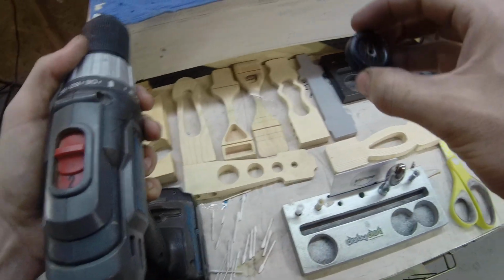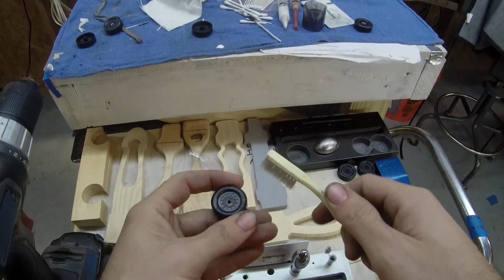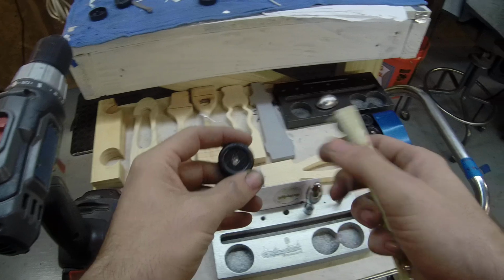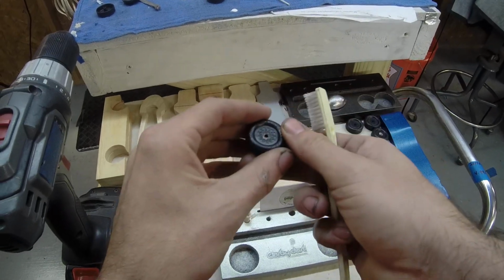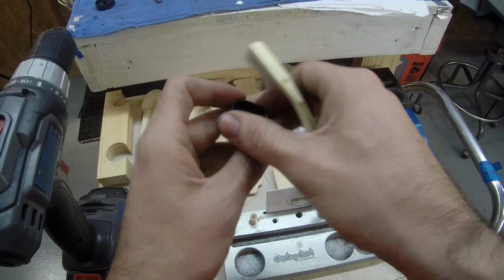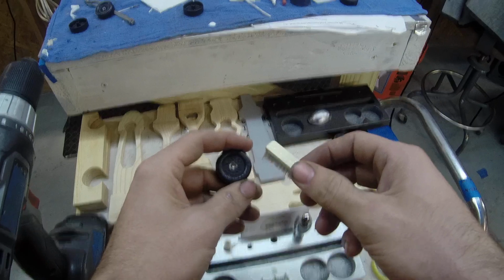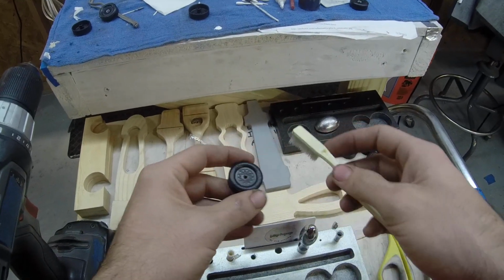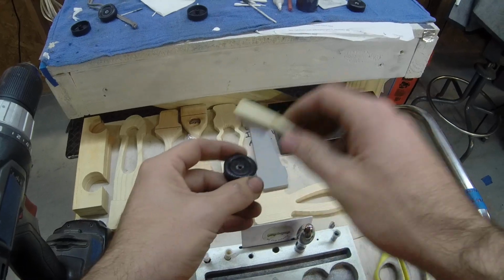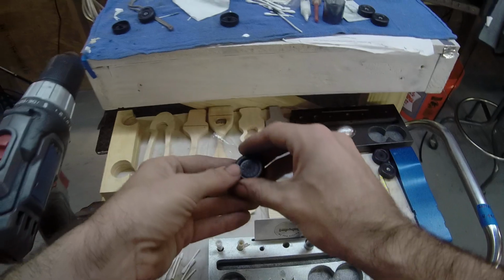And you can take this to your faucet or your sink with a soft bristled brush. Use cold water or lukewarm. Don't use water that's too hot, because these wheels are made of a real thin plastic, and I'm afraid if you get it too hot, you'll change the form of it. It'll melt it. So just use warm water or cold water, and it'll get it off just fine. Put it under the faucet, soft bristle toothbrush, and just scrub that excess off. Okay. Once you get it all scrubbed off, it'll look like this.